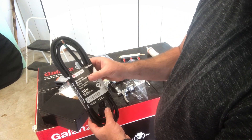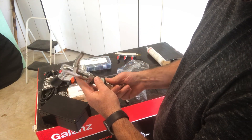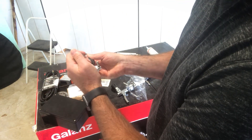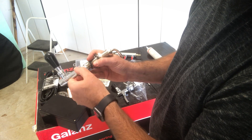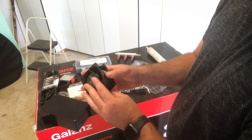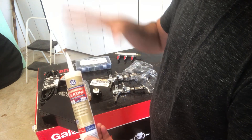Here's the project cable I will use to power the keezer. I picked up plastic wire collars to tighten the power cords on the project box. I plan on using two taps for this keezer. Each one of these taps costs around $40. Two features I really like about these taps are: one, they are spring-loaded and automatically close when the handle is released, and two, they have a shutoff valve on the side to shut off the beer flow when not in use. This is a cooling fan I plan on installing inside the keezer — I'll wire this fan to turn on when the keezer kicks on to circulate cold air throughout. Finally, I'm going to use silicone caulk to attach the wooden collar to the keezer.